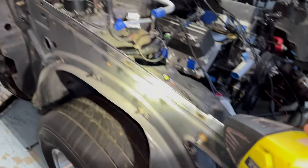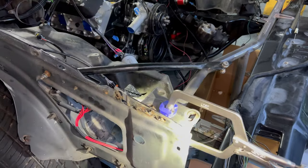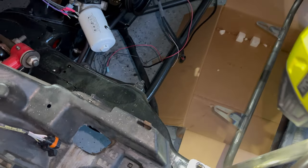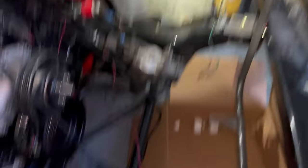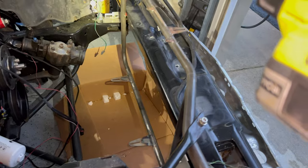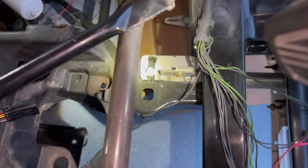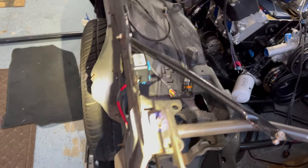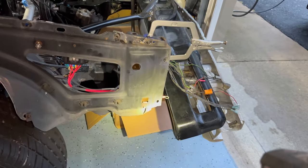Then you have a bunch of 10-millimeter bolts across the top. If you had the header panel in, there'd be a bracket here with two more bolts that go towards the radiator support. You can see them better on that side — one and two. There'd be a bracket going that way towards the radiator support, which is attached to the frame through these holes for the body mounts.